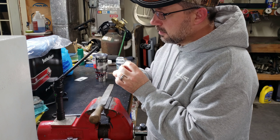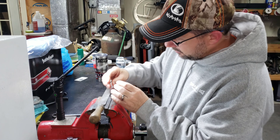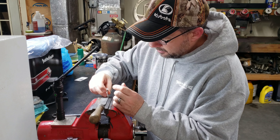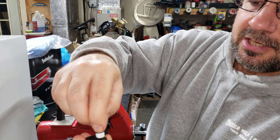You can see that right there — now I have a nicely radiused, smooth surface; there's nothing catching your skin anymore. I might take the angle a little bit more and polish it further. I'm barely pushing on the file — I'm not trying to gouge and remove a lot of metal, just trying to catch the jagged pieces sticking out. There we go — hopefully you can see that, we've gotten rid of all that roughness. The other thing I did was chamfer the back at approximately a 45-degree angle where each of these fins was, because I can imagine those potentially hitting the plate during rotation. I just shaved that back a wee little bit, got rid of that rough extrusion.